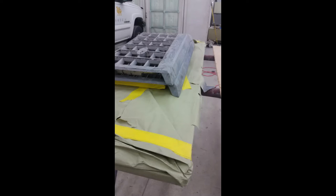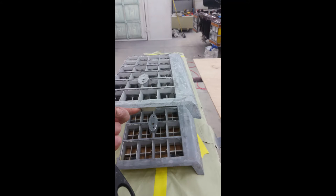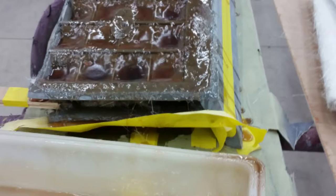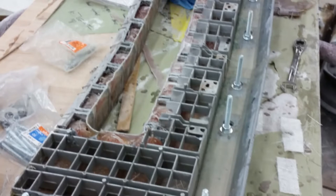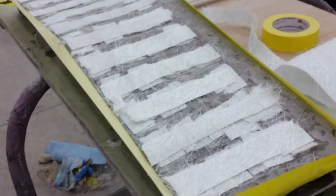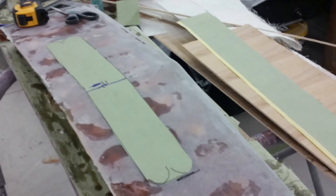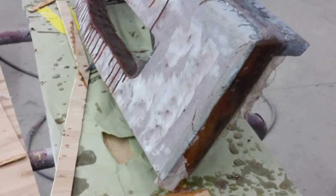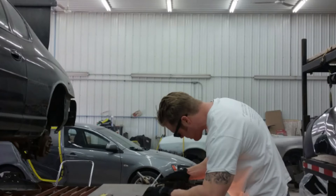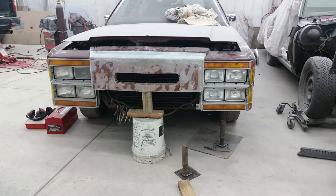That's where I overlay the two grills, and then I just basically fiberglass them together. It is heavy. If I do it again, I'd probably just do some foam and then form it to the desired shape. But again, I'm not a body expert by any means, so I just kind of did what I knew how to do. The only drawback is it is heavy — it's solid as a rock. But will it ever break? I don't think so. I think it would crack the actual front clip in half before it would break, but I've got plenty of brackets in there.